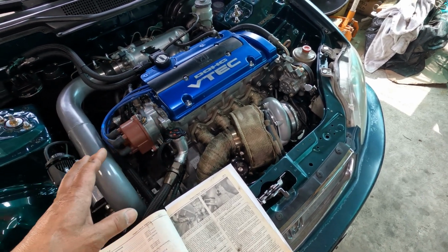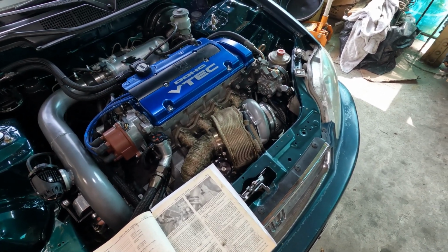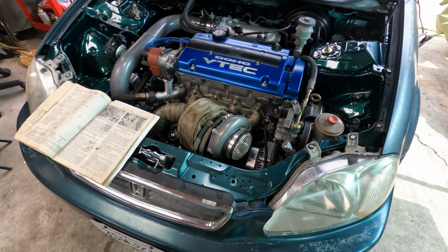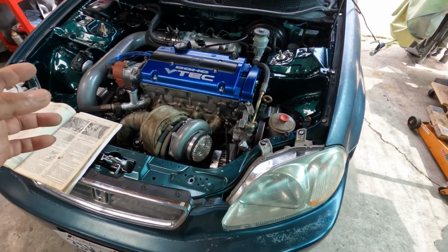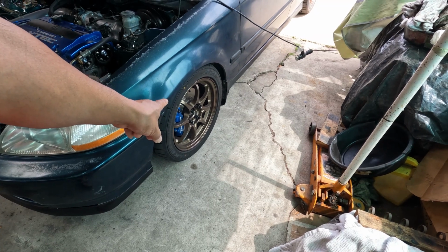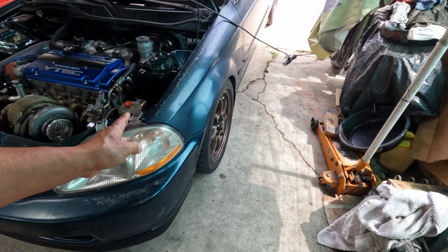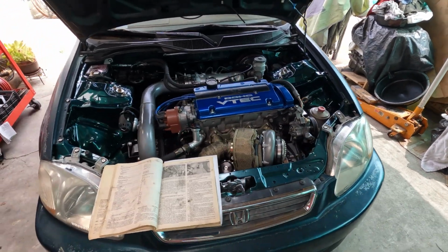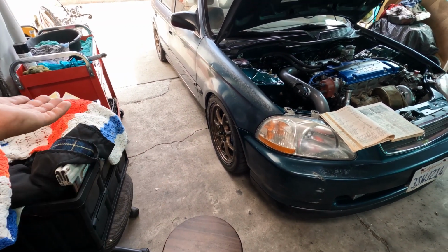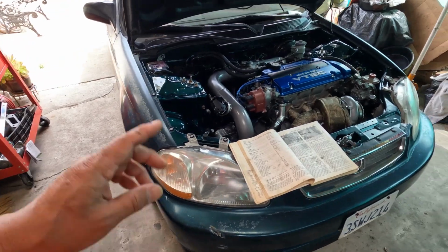I know some people have used it with no problem, but I have not seen much of a review on whether it is really backing off. Does it require a frequent interval, like a certain mileage when you have to go back and retorque it? Everyone knows lug nuts require interval retorquing, but we just don't do it. Believe me, it does require some retorquing. We are just very lucky it was a good design and it barely comes loose, unless you didn't torque it to the correct specs.